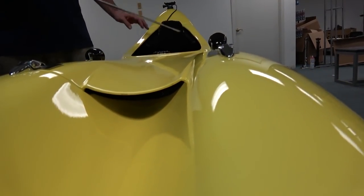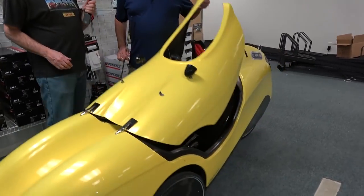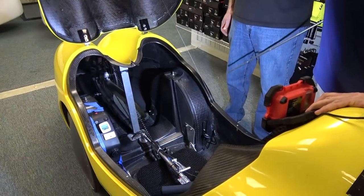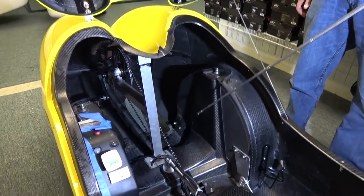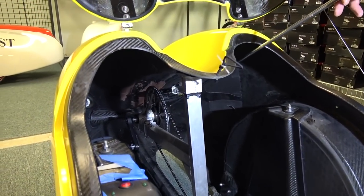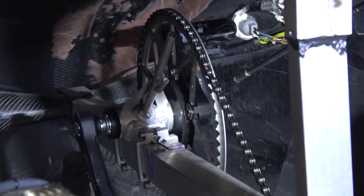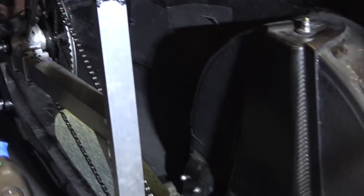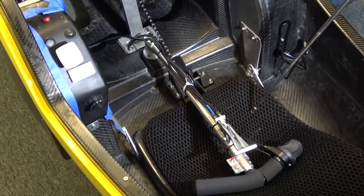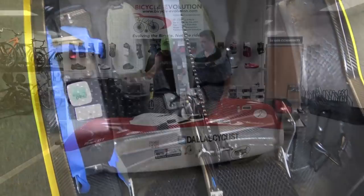Let's take a look at the hatch — you can step in and out very easily. Open up the hatch and you can get down to all the bike parts. This one also has a Schlumpf drive up front — a little button on the bottom bracket with the crank arm end. You push it to engage a planetary reduction gear, and then there's a chain line here with an idler. It's a pretty standard velomobile drivetrain from that aspect, with a moving bottom bracket for adjusting rider length.